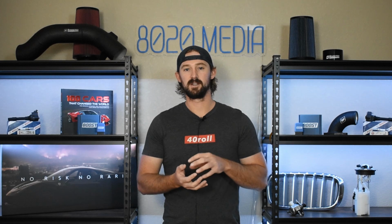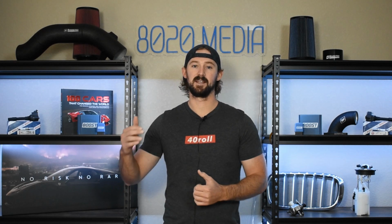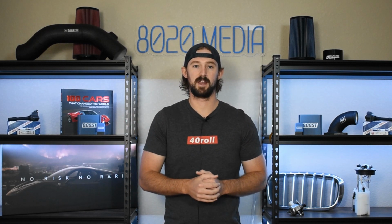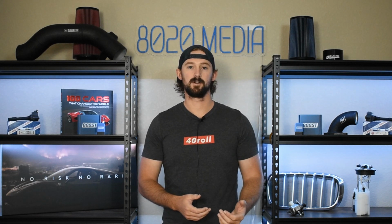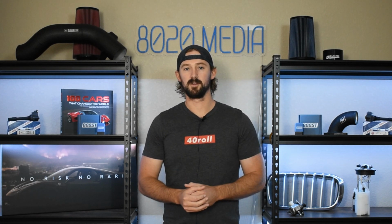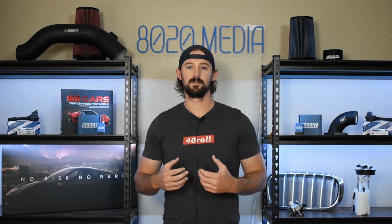And so tuning is really the building blocks or the most important piece to getting these engines to actually add 50 wheel horsepower to get in that 200 plus wheel horsepower range. Ultimately, you're not going to want to stick with just a standard plug and play tuner here. You're going to want to make sure you work with a custom tuner to smooth out your power band as well as to be able to handle the full E85 that you're running.